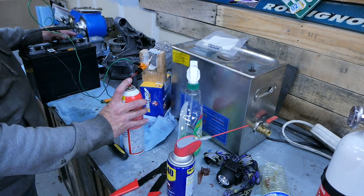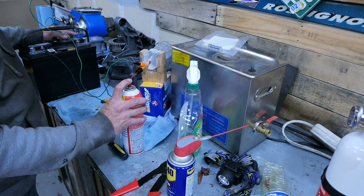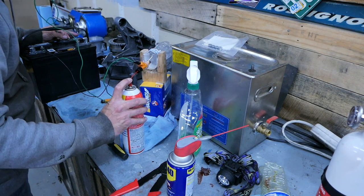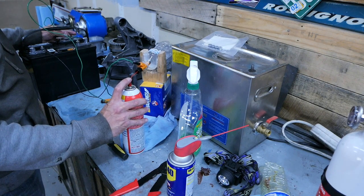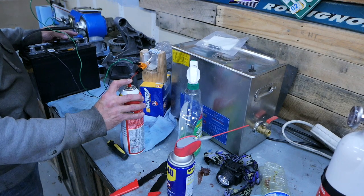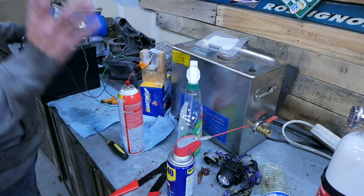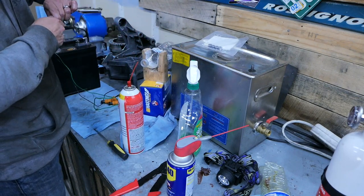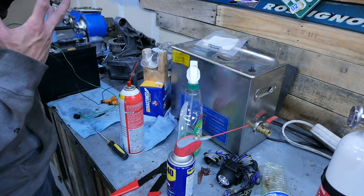Let's exercise that with the WD-40 in it. And there we go — it's got a pretty decent spray pattern there. Just going to do a few more. Now I'm going to hold constant pressure and tap, tap, tap. Just got to make sure we don't blow this cap off. There we go. Keep clicking until it's all out. This one is unstuck with a good spray pattern, so I know this one is a good one. I'm going to pull that cap off and then continue with the other two injectors I haven't done yet, and then we're going to be done.